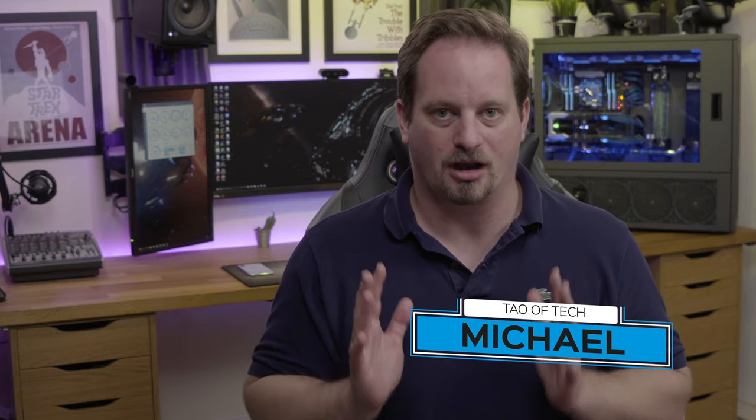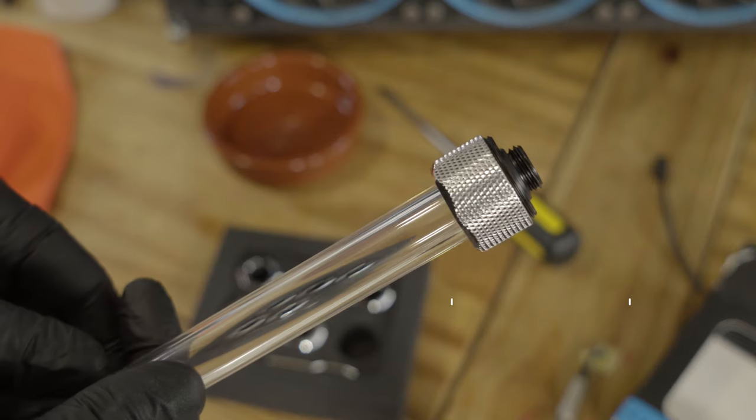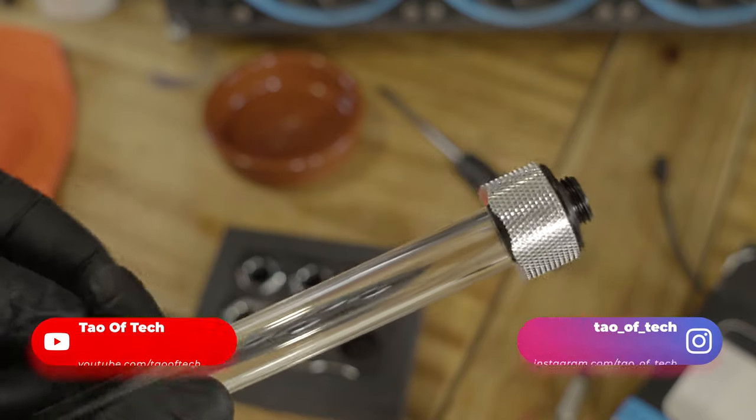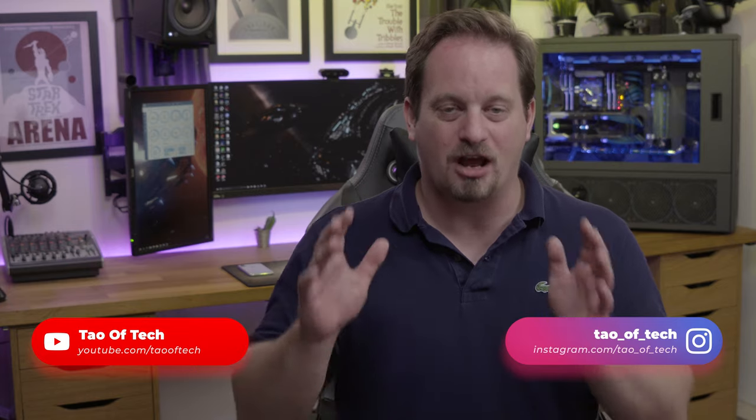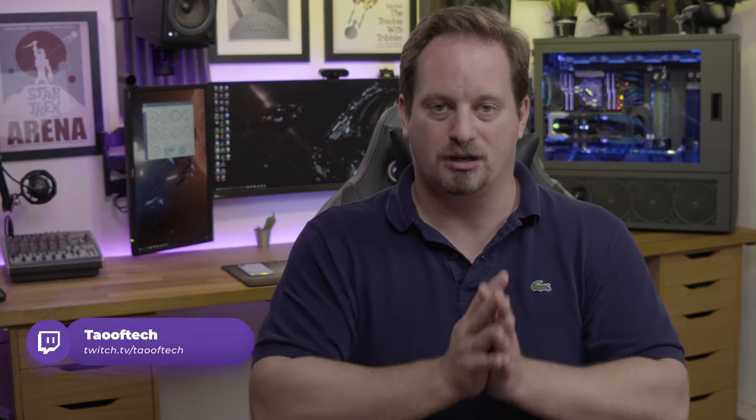So, of course, this is all a grand experiment to see if it was viable to work with glass to put in our rig. We've used 16mm borosilicate glass. That's a heat-resistant type of glass, very commonly used in chemistry lab experiments. Really well suited to water cooling, which is all about moving heat, and it's very conducive to being cut and broken. We did also use some new fittings.